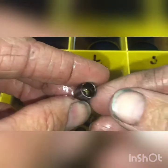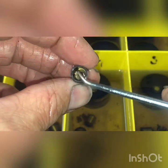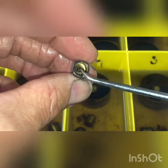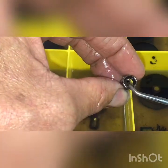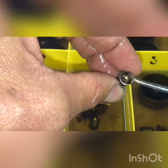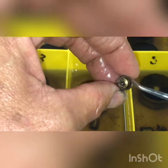Here's a good view of the little plunger in there. A good way to tell if you got it clean enough is you'll be able to see it — it'll be nice and shiny with no oil residue left in there. A good way to tell that it's working is to get a little bit of your cleaner in there, fill it up, and then start hitting that little ball and you'll see it drain out. See — that drained right out, so you know that ball is working. It was holding fluid in there and then drained it right out.